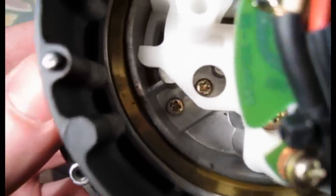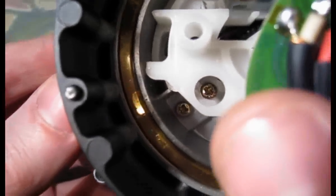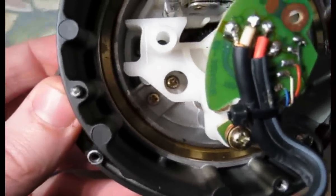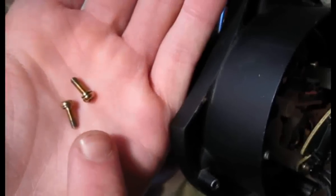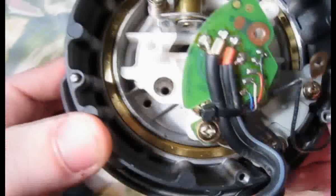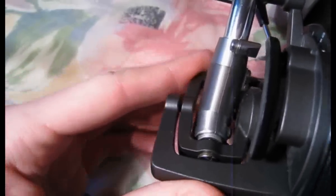In there, can you see there's two screws? That's directly underneath the circuit board. You've got one inside that white circle there and one next to it. Now if you take those two screws out — which I'm going to do now — that is all that's holding the tonearm on. I've just taken those two screws out and you can see they're not in their place. The tonearm — this bit — should just come straight off like that. Before you take this off, make sure that your anti-skate mechanism is set to zero before you take this out.